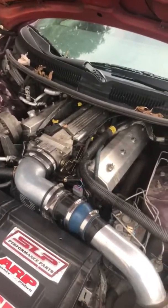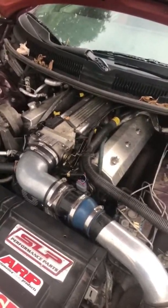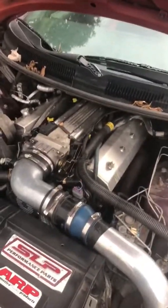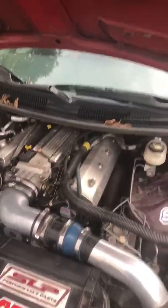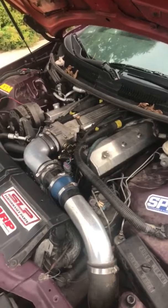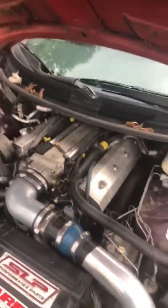The shakedown test went pretty good. It's not overheating. It's driving exactly the way I remember, which isn't the most friendly — it doesn't like to idle when it comes to a stop. Only when you come to a stop; if I fire it up now it'll idle great. Drive it around the block, come to the first stop sign, and it will either stall or come pretty close to stalling. My oil pressure gauge seems to have fixed itself — it's accurate now with my AEM gauge. Everything's going good so far, but I'm going to try throwing in the stock injectors and see if that solves my idle issue.